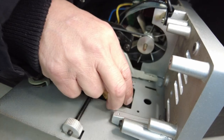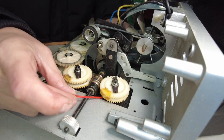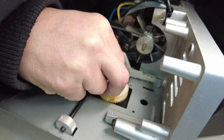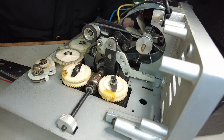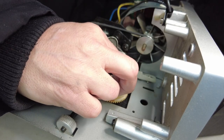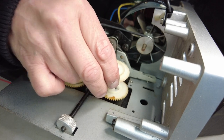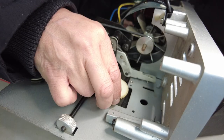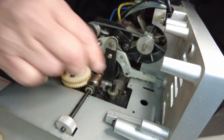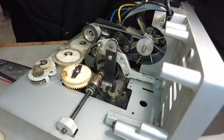I'm at a real standstill here because I really don't know how to get penetrating oil in there — my penetrating oil does not have a straw. I just couldn't help myself. I had to do something here to try and get this apart. So I'm going to lift that top spring off, put it aside carefully, remove the washer carefully, remove this arm carefully, remove another washer, and just slide this gear right off of there. Now I have great access to that stuck shaft. Let's spray some oil in there and see what we can do.